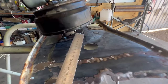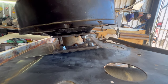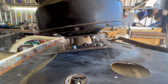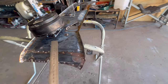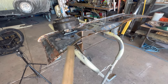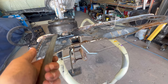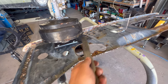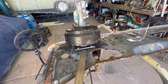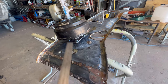You can see I've got enough clearance to get the nuts in and out. These are going to get welded to the plate to make life a little bit easier, but for now I'm not going to do any more welding. I'm going to pretty this up because it looks very agricultural, then fit it to the one-tonner — the one-tonner has a motor and inner guards and I want to make sure nothing is compromised before I go ahead. The booster itself is about 30mm smaller, but it does stick out about 30mm further than a standard booster.